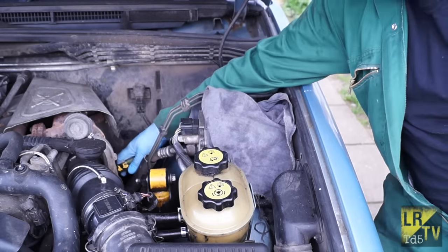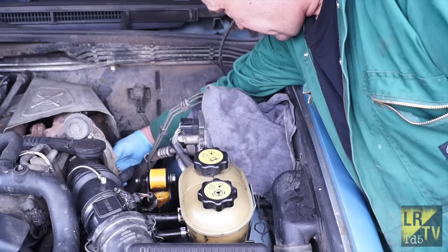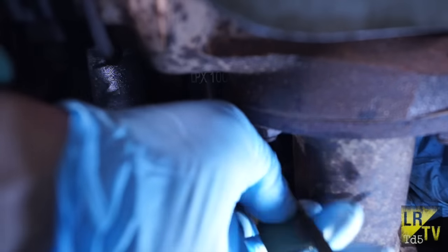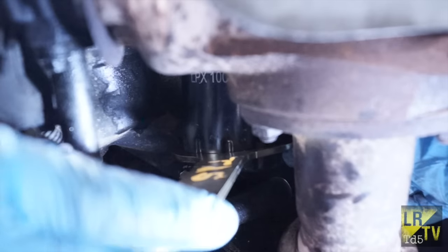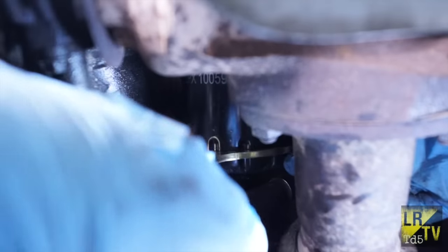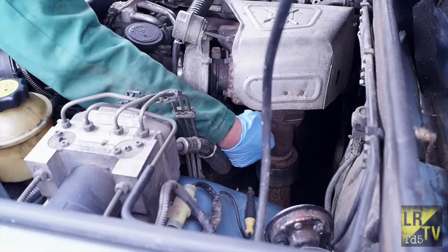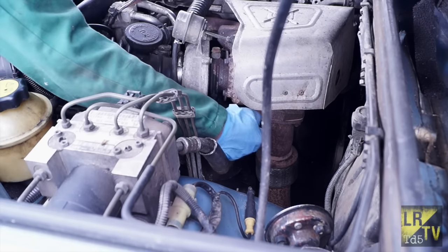We can attack the filter — it has to be down there in the most awkward place imaginable, and you can see it is a little bit of a hassle. What I've done is got one hand around the exhaust and then I can pull with it to undo it. Some of you that have already been doing this type of job on your TD5 know how awkward it is to get this filter off.